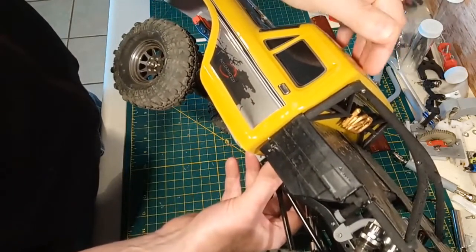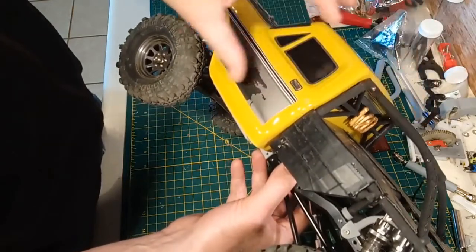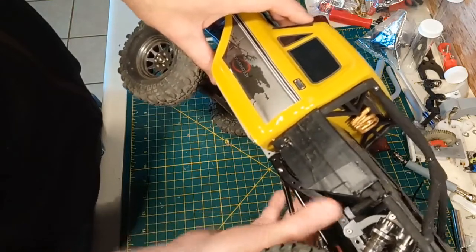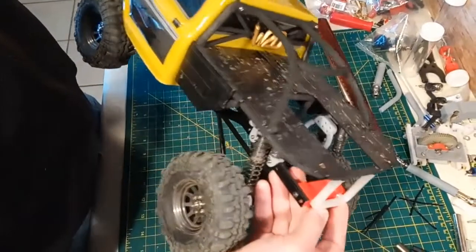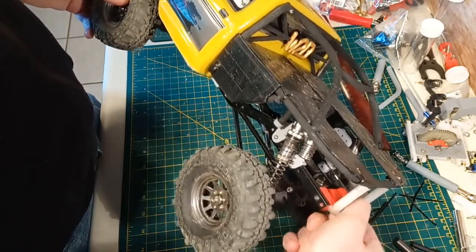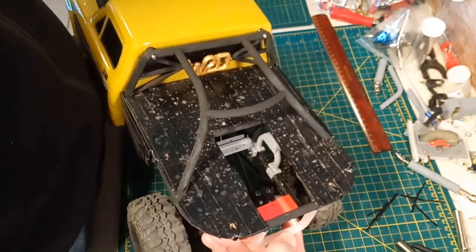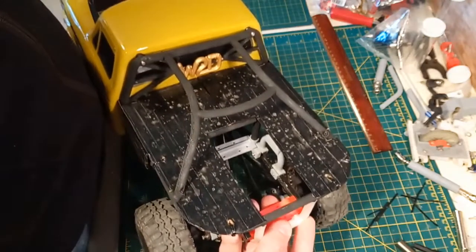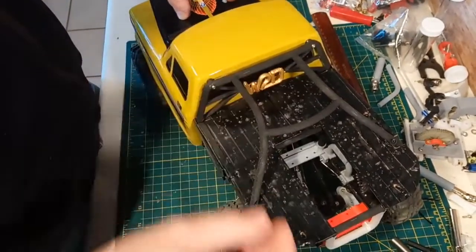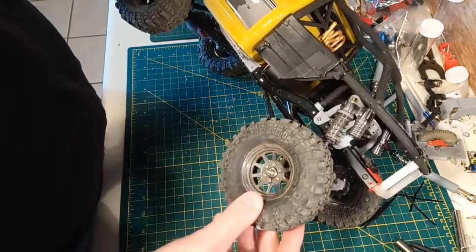If you go with the cab mounted version, similar to the typical back half, you don't need that cross brace 100%, guys, but I think it'll definitely add a little bit of strength. And if you go without it, you can definitely use this back mounting setup that I made here. You use this bumper mount, and this just slides into the bumper holes. A little bit hard to show you here. There we go. So it just slides in and anchors the whole thing together. I use TPU, so I'm pretty sure the strength will be no issue whatsoever. But if you use PLA, I'm not sure. This might not hold up. Something to try out, guys.